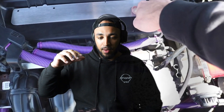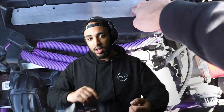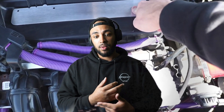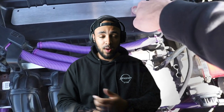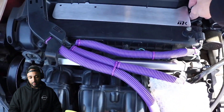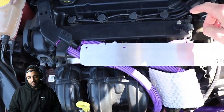What I did before sending these out — I get a cable tie, wrap all the HT leads up, pull them into the gap in the rocker cover, tie them down, then take the cable tie off and the spark plug covers haven't caught since. It hasn't done any damage to the leads — I've done it with Burton Power HT leads too. The more performance ones tend to be more flexible, whereas stock ST150 ones, especially if old, are quite rigid. Aftermarket HT leads are a bit more flexible, which might help.